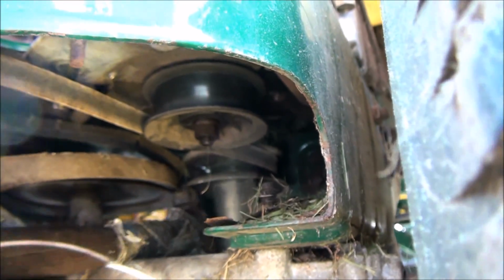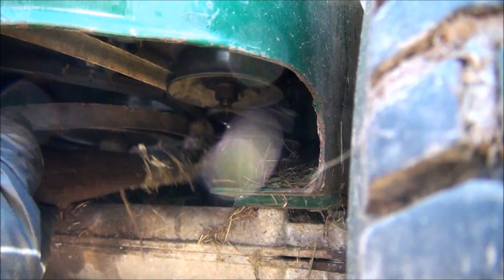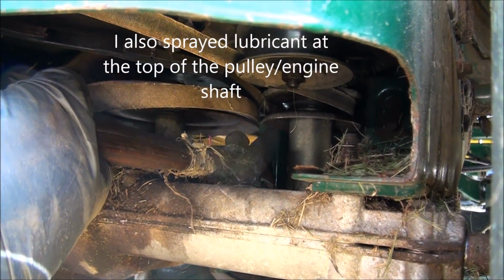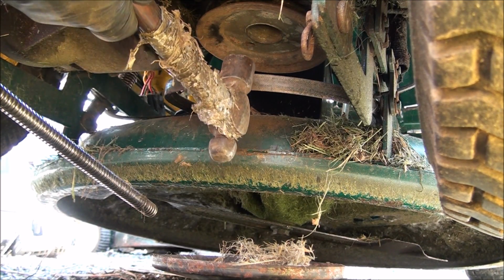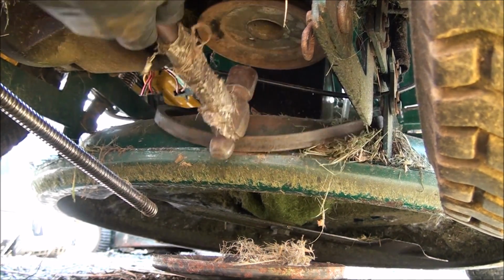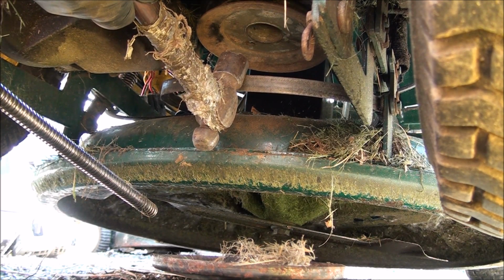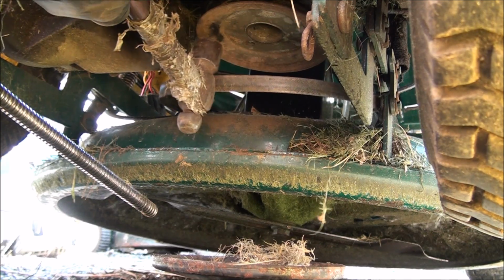But I will. Yeah, I'm basically just up in here like this with my hammer, banging on it, and I can see it moving slightly each time, so you can check it. I'm getting some movement out of it. I'm actually hitting it back up and pushing it down here, which you can watch. I'm going to make sure the belt on top is off of this pulley, but eventually I'll work it free and it should just slide right off the shaft.